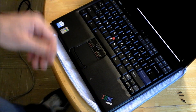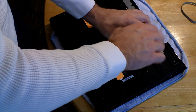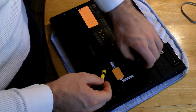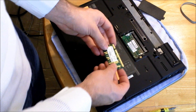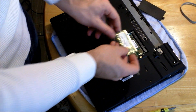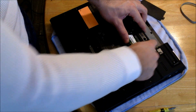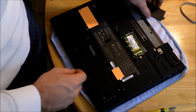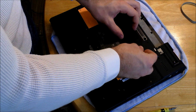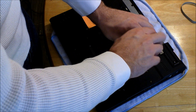And that's how you access the RAM. To get to the other stick of RAM, it's right on the bottom — just one screw. Pop this panel off, and then you can add another stick. Just make sure you line up the notch, push it in at a 45-degree angle, make sure it's fully seated, and then push it down and replace the cover. And that's all you need to do.